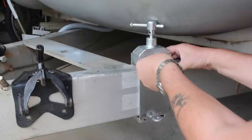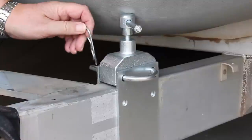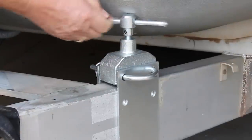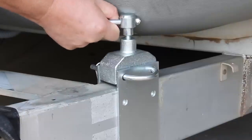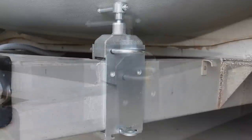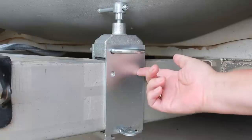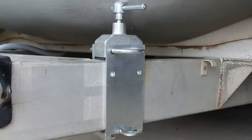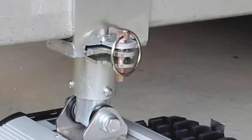Once the bracket is held in place with the shoe section and U-bolt, the U-bolt is again held in place with two spring pins. The shoe is then tightened onto the drawbar with the top handle. The bracket is pre-drilled to accommodate both 150mm and 100mm chassis. A slot at the base of the bracket accommodates the tongue of the suspension fixture on the camper trolley. The front is held in place with a spring pin.